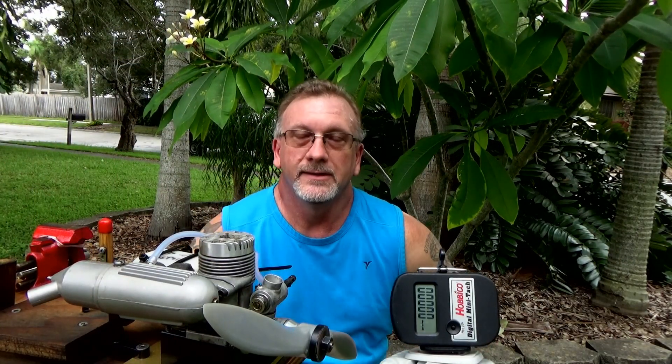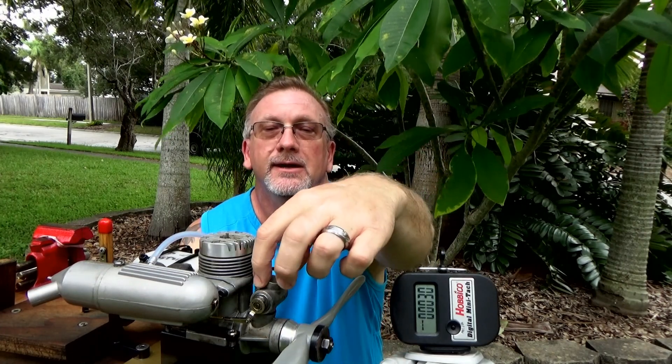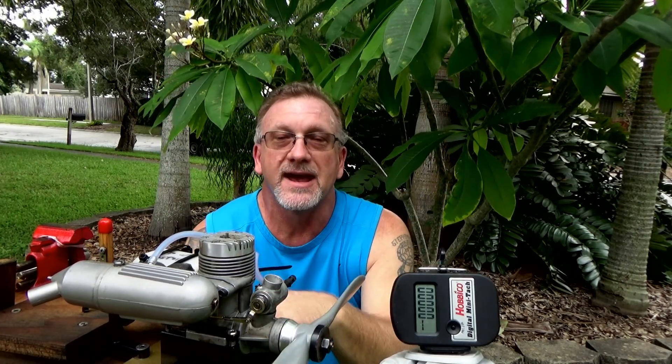Hopefully that video will come out okay and you'll be able to see that I didn't experience any binding at all in that throttle, in the barrel moving. It just felt smooth as silk. Now, the only thing I did do, Ed — which I did tell you on the phone when we just spoke — was that there was not a washer, a lock washer, underneath the head of this barrel retention screw, such that if you were to screw that screw all the way in, it would contact and bind the throttle barrel, pretty much making it almost impossible to move at all. So all I did was I just dug up a lock washer, put it under that head, and tightened it down all the way so that the screw's not going to work loose.